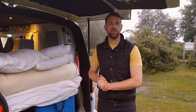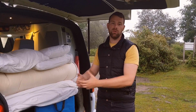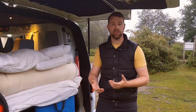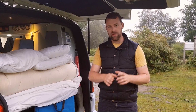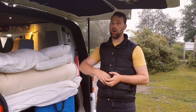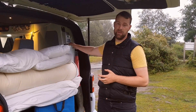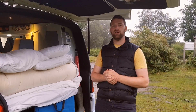So in those situations, where I'm away for a month and I'm not always guaranteed to get any proper 240 volt hookup to charge it, when I'm wild camping, staying in random places, not on campsites, I need as much energy as I can get in the battery. And this system in hot countries in the summer will give me a bit more charge. It will work better. The downside is on cloudy days in the UK, this system won't give me any charge at all to that battery, whereas a PWM will trickle in slightly and help maintain that battery. So they're two systems. The MPPT ones are generally a bit more expensive, can be a bit more unreliable. Totally depends what system you want to use.